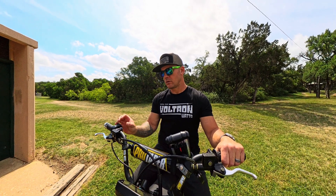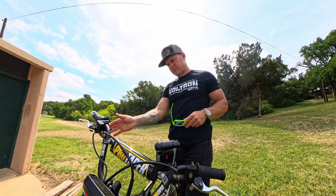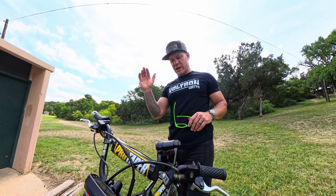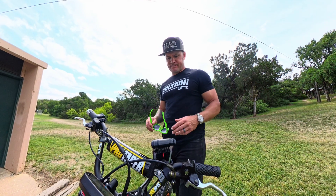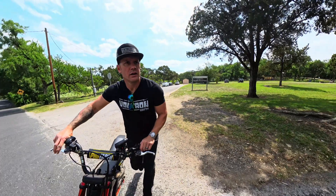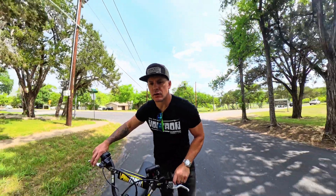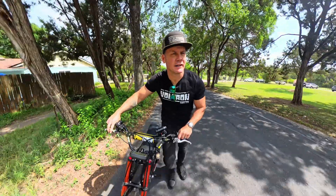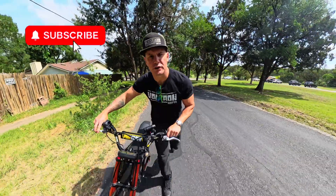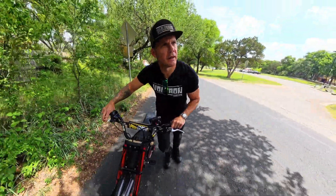The bike was running perfectly fine, I went to the bathroom, turned the key off, turned it back on — no workie. I've unplugged the battery, cycled the key, drained the controller of all energy, plugged the battery back in, and cycled it again — done this about three times. Still stranded. Per the Relive app we've gone seven miles. As I'm pushing the bike home I'll keep checking it periodically — if it comes back on I'll restart the video; if not you'll know I pushed it home seven miles. I'll put in a message to Soshan to figure out what the problem is.